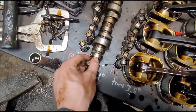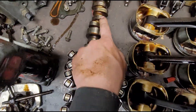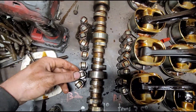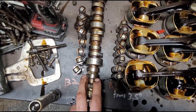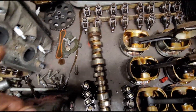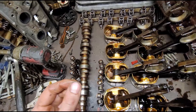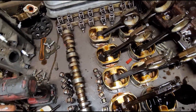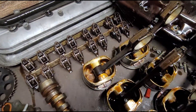The cam looks pretty good. There's some dirt in there, but this is all going to get cleaned. There are no grooves in it or anything. I might just try to get new lifters anyway since it's all taken apart — I'm probably not going to be able to afford a new cam, but that'll be alright. I did notice that on one of my push rods the end of it is getting kind of ovalled, so I'll probably have to replace that one push rod for sure.